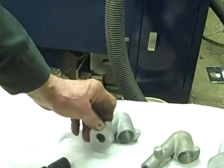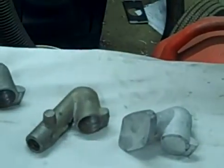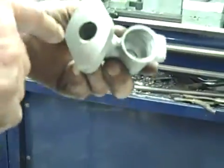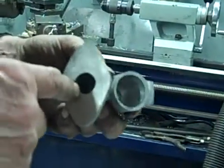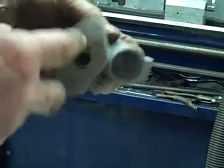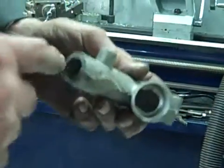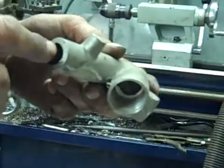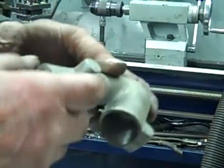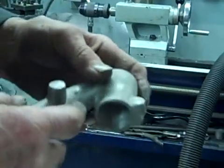Now these are the intake tubes that I had casted. So that's the solid style. And then you have your choice really when you bore these out. You have a flange, you can take the flange off. Otherwise you keep the flange on, you can mount different types of carburetors for them. Although I think the carburetor would be original, I think it's called a Breezy carb. Then the next style, when they improved these later on, probably around 1918, my guess, they actually put a butterfly. So this is casted so you can actually bore this out and put a butterfly into it. So you got some control of speed with it for throttle, but not very much.